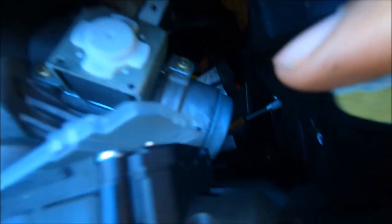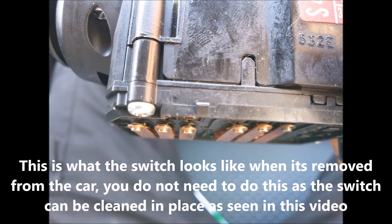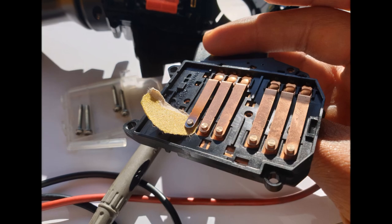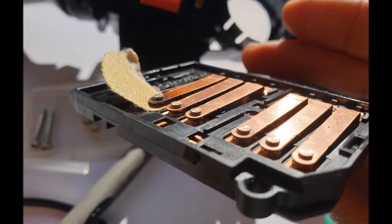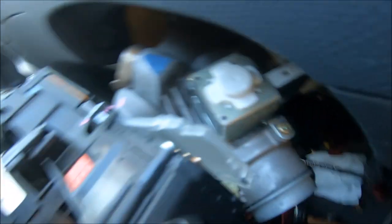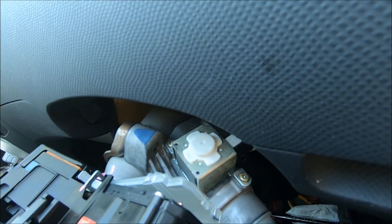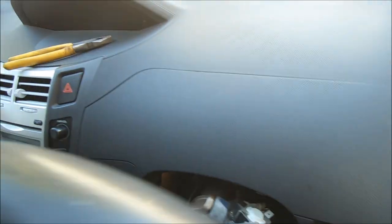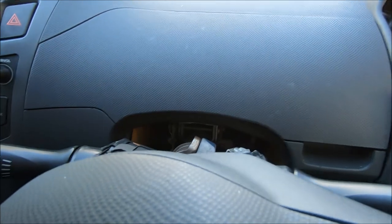I'll put up a picture now so you'll see what I'm talking about. It's a bit hard to show you exactly how it's cleaned but I'll try my best. You have to put it in there and give it a good sand — you can pull the switch to close the contact and do it like so. Usually in these Vitzes that's the main problem. The easy way to tell is if your high beam is playing up or your low beam: if your high beam is playing up then you won't get the indicator on your dashboard, but if the low beam is playing up then your low beam circuit will not work.